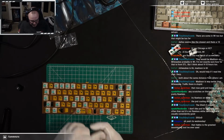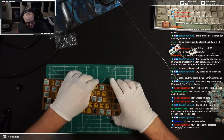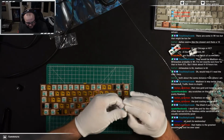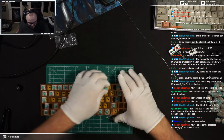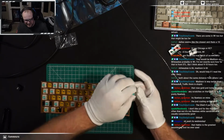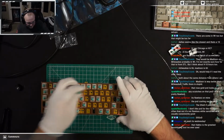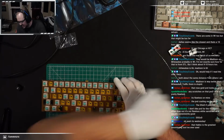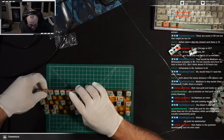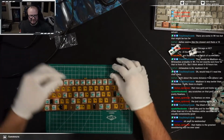It wasn't in its nice holder, but I don't know what better endorsement there is than I came back and it still worked. It needed two fairly inexpensive parts replaced, parts that wear out over time anyway. It needed a new rubber seal for the suction chamber, because it wasn't holding as strong a suction as before, though it was still functional. And it needed a new tip because the original tip fried pretty bad.